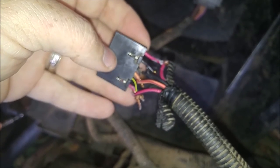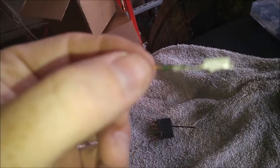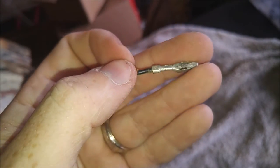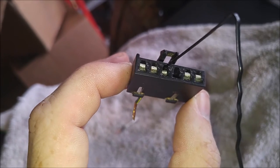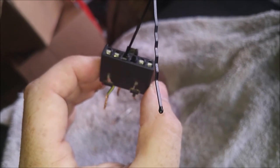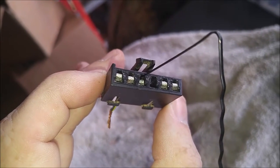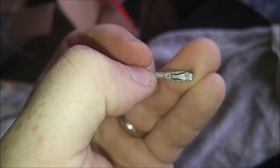So hang on. Some of these are really short, like this one. We're just going to use the old bobby pin trick. Let me see how short that is. Use the old bobby pin trick and pull these out where you put the bobby pin. You clip off. There's a little nub, and you clip that off. And these fit right inside there. And then you're able to push the pin down. And basically what that does is push that release down and you're able to slide it out.